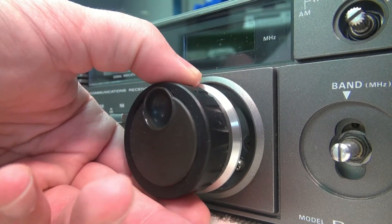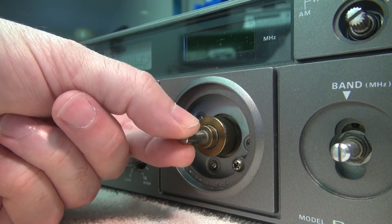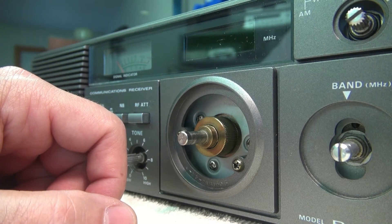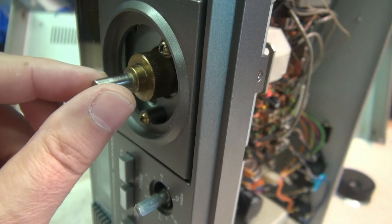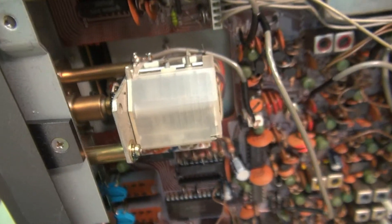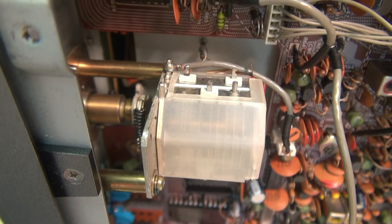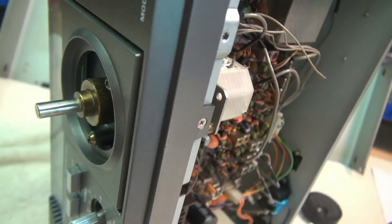What the problem was: you can simply remove the dial, and behind it there's a vernier. Like all the old tube radios we're used to, the lube in the vernier dries up, gets gummy, and starts causing some VFO jump. That's what's going on with the R600. You see a little shaft there that spins and the outer shaft spinning slower — that's the vernier action. Come around to the variable capacitor assembly — you'll see a set of gears down there for the backlash. The vernier gets gummed up, and then these little gears jump back and forth on the spring, causing the backlash. The way to fix it: lube up the vernier.